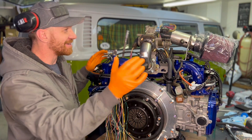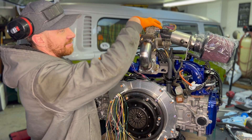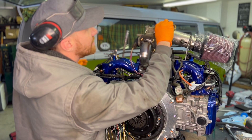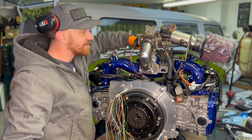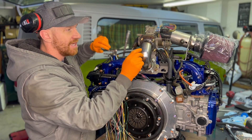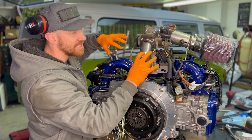That was the powder coating oven — it just went off. So the way that this was before is this throttle body assembly was down here, and all these electrical connections that go to the idle air control valve, the throttle position sensor, and even over here the manifold pressure and temp sensor — they all fit just fine, no big deal. But since we have this to clear the firewall where the gas tank is over here, there's not enough clearance to just have it in the stock position.